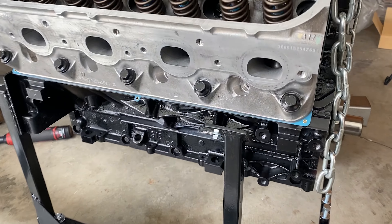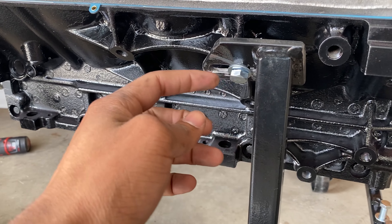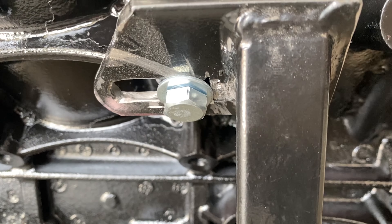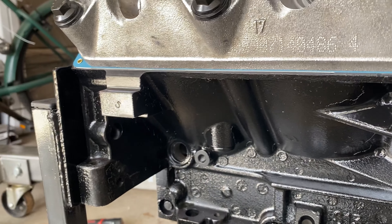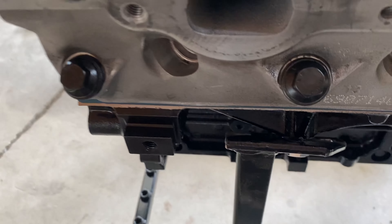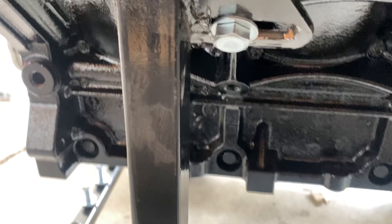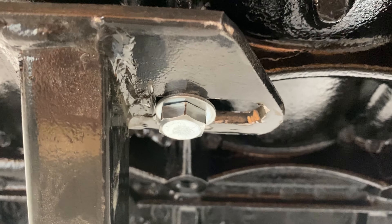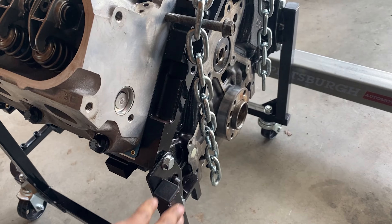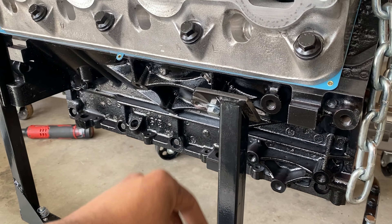I would say at least a half inch is what you're gonna want to cut off and this will fit on there perfectly fine. This is the LT engine cradle on an LS style engine. I went half an inch forward on this side — as you can see there's a little bit more than I needed, but when you're lining this up you are gonna need that extra play. So I'd recommend at least a half inch. You can see a little bit of light on the front piece down here as well. You don't have to touch anything in the back.